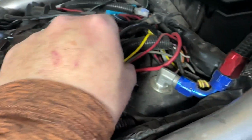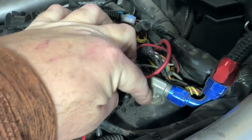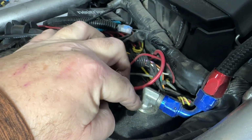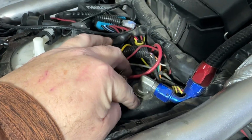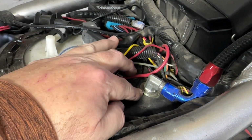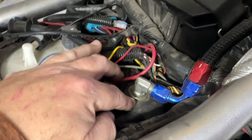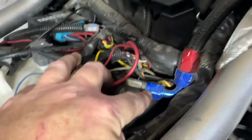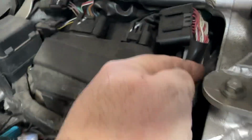This is where I put my bulkhead fitting, and you can see the seal washer right there, and you can see how the bulkhead fitting comes up at a 90 degree, and it's shaved off. The bulkhead fitting is shaved off down in the tank. Ernie did that, and it's a real low profile inside the tank. You can see the bulkhead fitting comes up at a 90, and then I've got another 90-degree elbow here with the fuel line running up and inside.